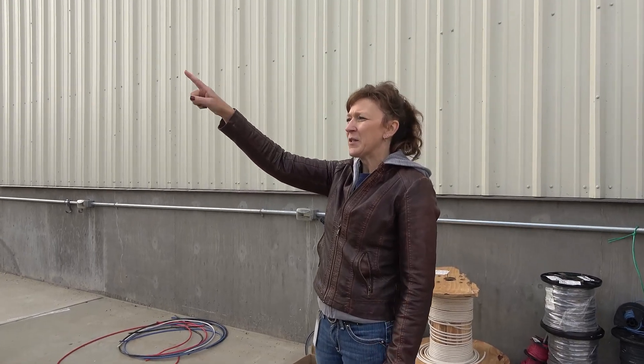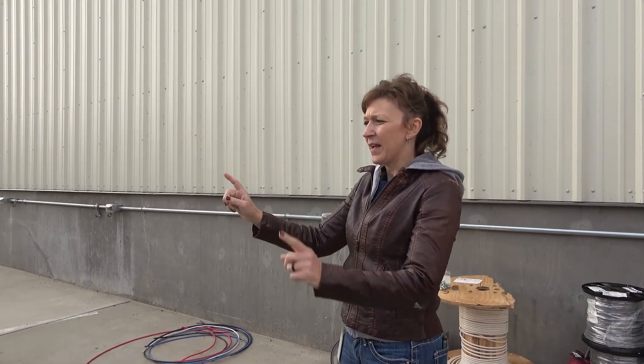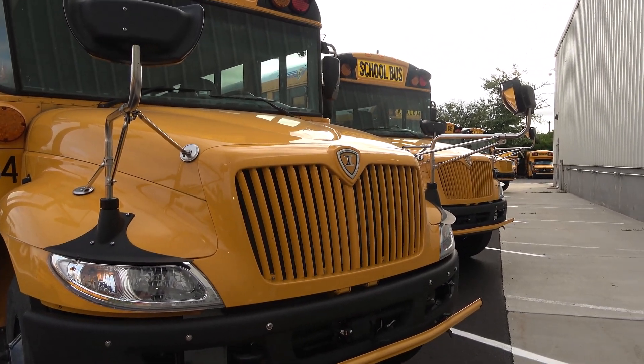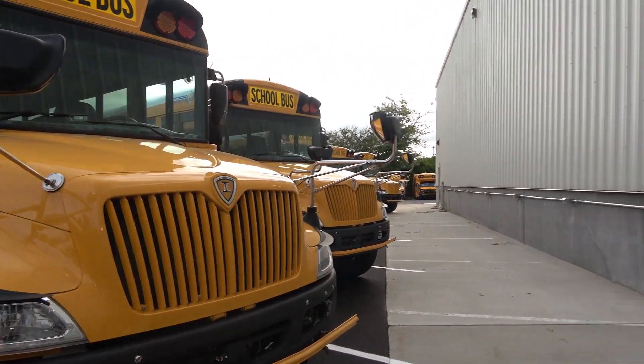My clearance lights, my 8-way student lights, turn signal hazards, and headlights high and low beam are all securely mounted. They're not cracked or damaged, and they're the proper colors: red, amber, and clear.